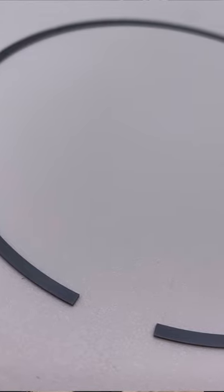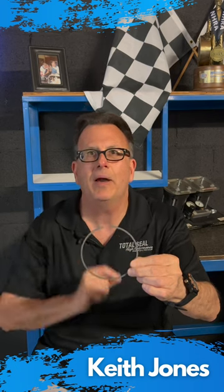This is the open state of the ring. One of the numbers that you want to be recording when you're building your engine is not only how much end gap you set it at, but also your bearing clearances, side clearances, how much end play the crank has got — you want to record that free gap. It's a very important number that tells us a lot about how the engine's performing when we disassemble it.